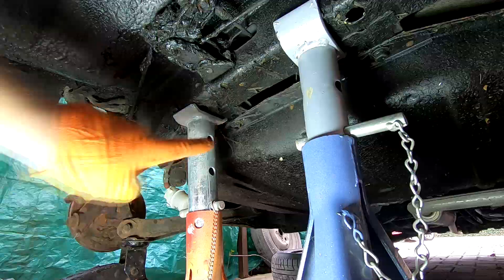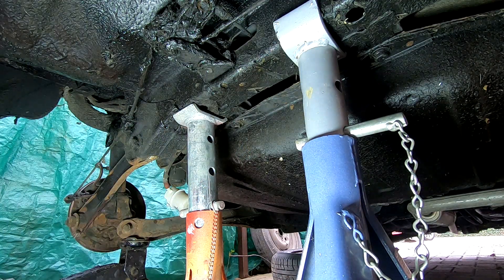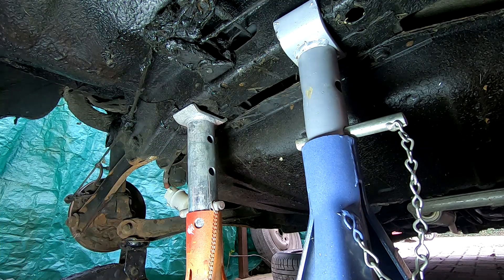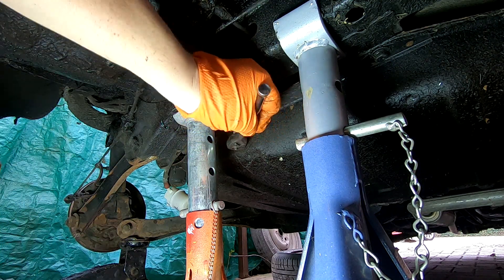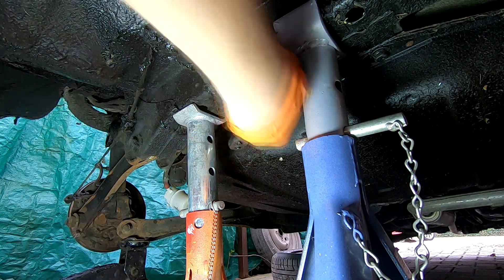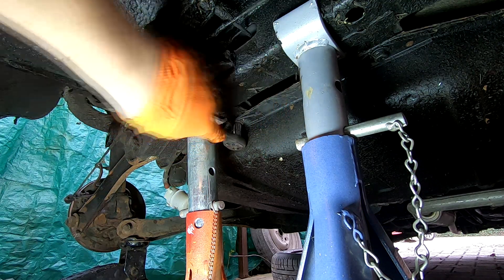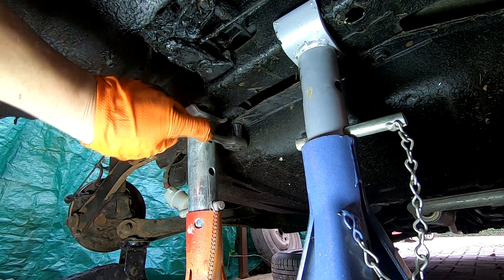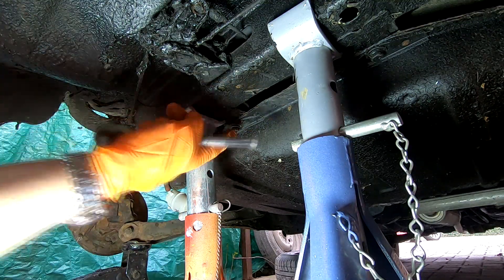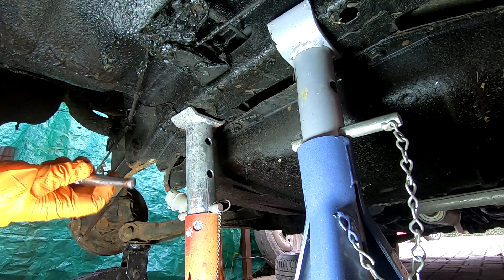That clip came off pretty easy. Now I've got these other bolts to contend with. I think they're 13mm — let me get a 13mm. No, it's 12mm. These are nice and loose — not seized up. I'm not going to take them right out yet. I don't think there's any fuel in the tank. Dave reckons you can just loosen these off, and I think he might be right. The tank is coming down — there looks to be a gap, maybe. Actually, I think they've got to come right out.